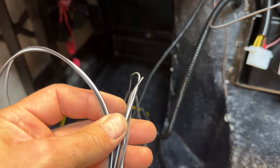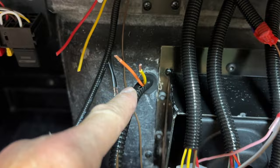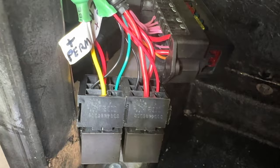We've still got to put power and wire up the fuel pump into the CANEMS. There's a long black-and-white fly lead coming from the AK loom — that goes to the reverse on the gearbox if you've got a TKO gearbox. I ran some wires up from the proper connector so I've cut my black and white wires short. I don't think the polarity matters — just going to connect them up there.